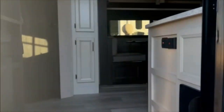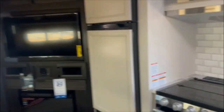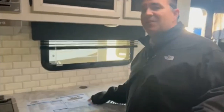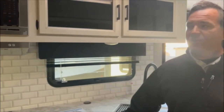Come on in — they all have the screen door. The 29BH has a dry weight of 7,500 pounds, so you'll definitely need a three-quarter-ton truck to tow it, as you'll be around 10,000 pounds gross weight. Don't travel with water on the highway — you're just carrying unnecessary weight. Get closer to your destination and then bring in your water. You have 55 gallons of fresh water, 61 gallons of gray, and 30 of black, so plenty of water capacity.